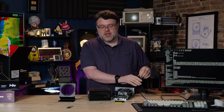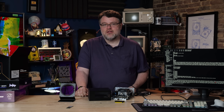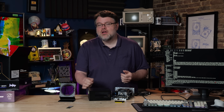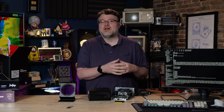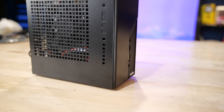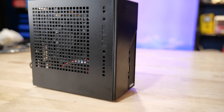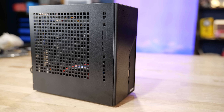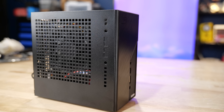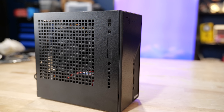Keep in mind that the power brick is up to 120 watts, but we're rarely anywhere near that — some ASRock configurations include Thunderbolt peripherals and tunneling as well. This is an extremely tiny and overkill micro server platform where you can run RAID 1 SATA drives, plus NVMe, plus 128 GB of memory and 16 cores in a tiny package at 65 watts at the wall.